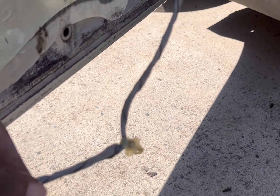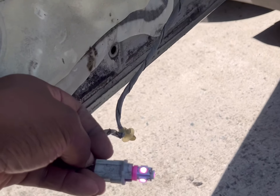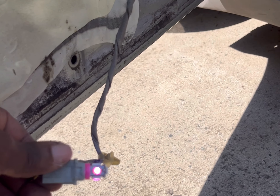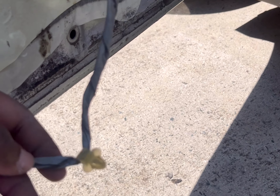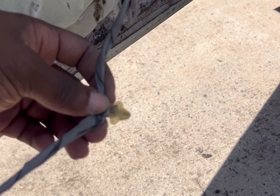This light bulb is tapped into the door panel — just twist it counterclockwise to remove it, then pull it back. There's also a push tab in there as well; just pop that out by pulling back on it and it should just pop out.